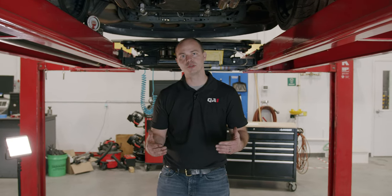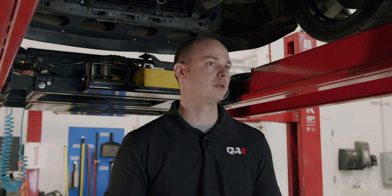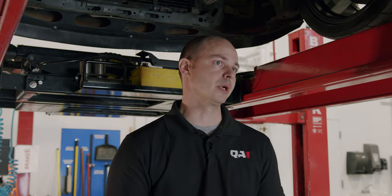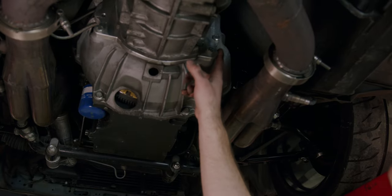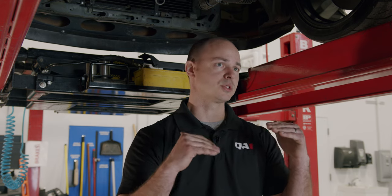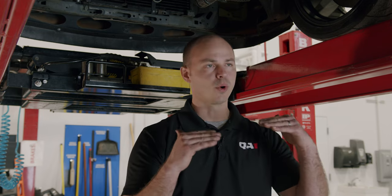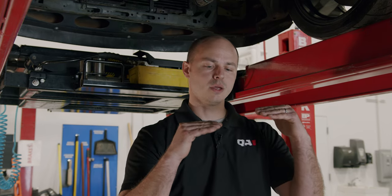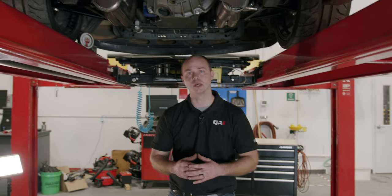When we're looking at pinion angle adjustment, we actually need to look at the entire driveline and the angles associated with the driveline and the driveshaft in order to get everything set appropriately. We really need to look at the entire driveline as a system. We want to figure out what angle our engine and transmission are at so we can make sure that our pinion runs at an angle parallel or close to the engine and transmission angle. We want to have them run approximately parallel to each other, and we'll adjust the pinion up or down a little bit depending on the application and the vehicle.